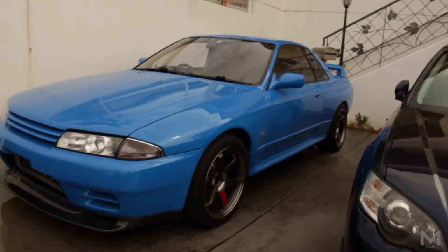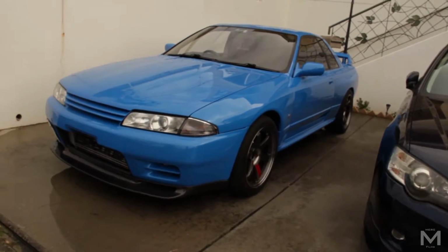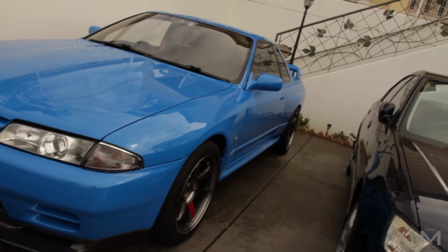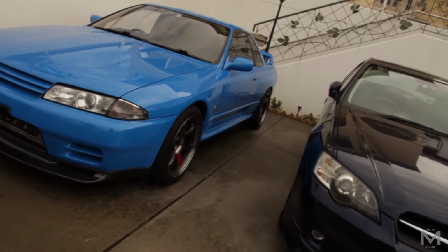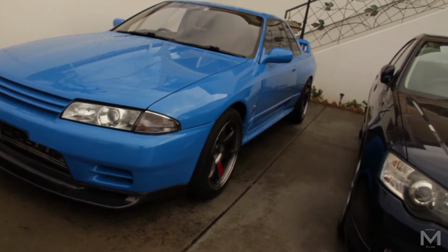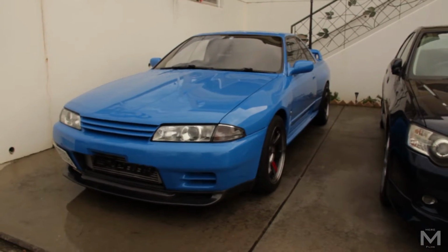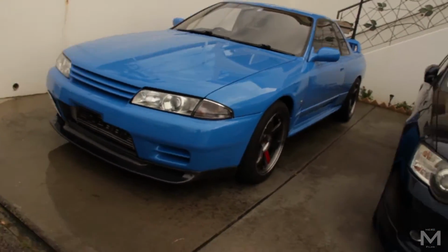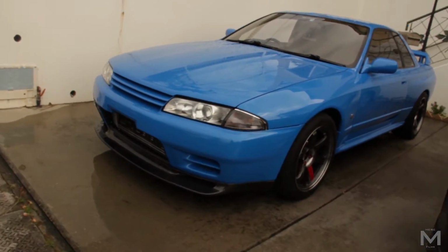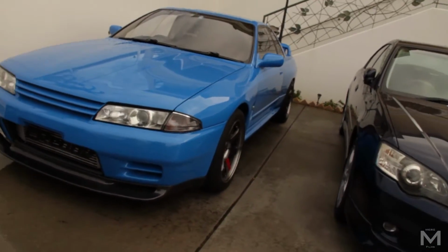I also want to do a two-way rear diff. I don't know what kind of diff I want to go with, but I want a two-way in the back. Because I was open diffing pretty hard at autocross, especially when I was coming out of turns, and I don't like that. You can feel it when you step on the gas. You just feel the one tire fire going on. People were telling me they could see it too. We can't be having any of that, so I want to do a two-way this year, and then maybe a 1.5 way in the front if I have to. It's not really a priority, I'm just thinking about it. Like a Nismo 1.5 way front diff would maybe be a pretty good idea, but we'll see how the two-way does and how I go about the car.